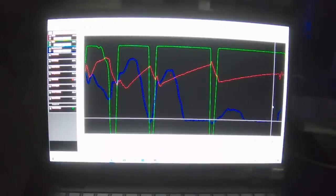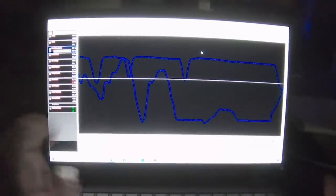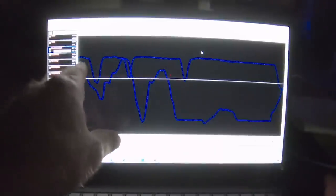Now, I thought this was all because there wasn't enough fuel in the tank. But what actually happened, and I'm gonna turn off everything but fuel pressure, so there's our fuel pressure through our run. What actually happened, and I'm going to open a comparison data log, is I ran out of fuel pump. The dotted line is the day after drag week when I took out our non-brushless fuel pumps from the fuel cell and installed a higher power brushless pair of fuel pumps in that fuel cell.